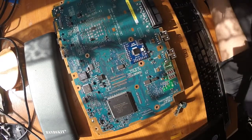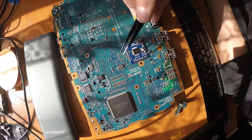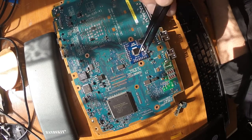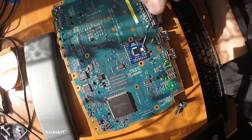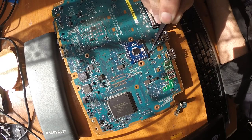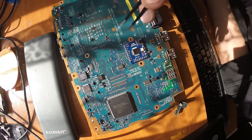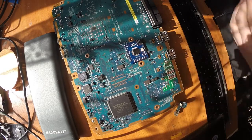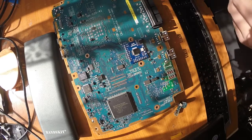What I wanted to say to you is that you want to position the chip in this direction, so that your 3.3 volt line, ground and reset are facing the USB ports, because for example you can use the ground point on one of those USB terminals or here or wherever. Ground is common, so 3.3 volts will go right to this side, so you will need very short wires for the power supply to the Modchip, and in my opinion it's the best way to position your Modchip. And now we'll start adding some wires, and I hope we will succeed in modding this console.